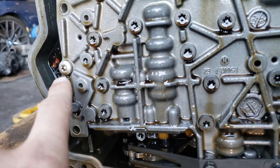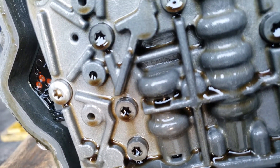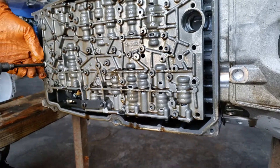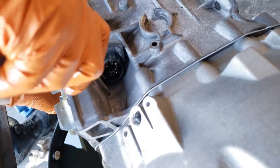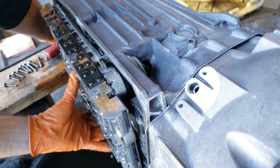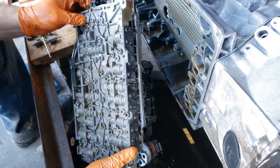The screws you have to remove are these, so just make sure you don't mix them up with these, because these are the ones holding the whole valve body together. Make sure you remove these — they're kind of rounded off. Moving it to the side a little bit to drain more of the oil. The most important part: make sure you use something to press down on this plug. It has to come out with the whole assembly. There are O-rings around this so it kind of sits in there pretty good — this orange O-ring right there. If you just pull on it you will break the conductor plate plug and it's going to be basically trash.